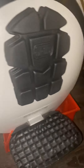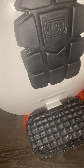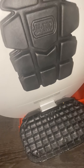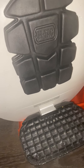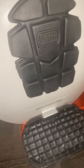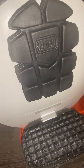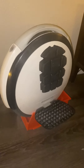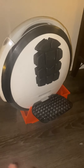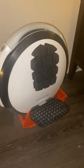I highly recommend calibrating it often if you fall — it did help me a lot. One more thing: tire pressure. I put 50-something pounds in these in the beginning; it came with 30, and I'm back down to around 30. Lower pressure does help stability, though it doesn't help handling. Just think of a flat tire and how much more surface area you have. Start there — you will get a pinch flat eventually if you keep it low, but lowering the air pressure, taking those plastic caps off, and putting the pads on the sides — you'll be amazed at how different the machine acts.